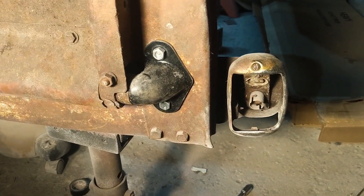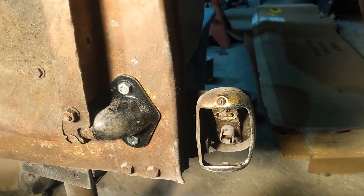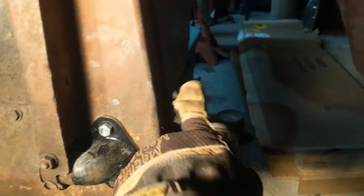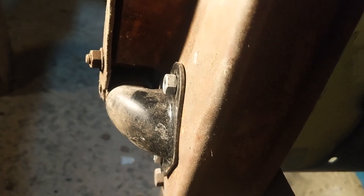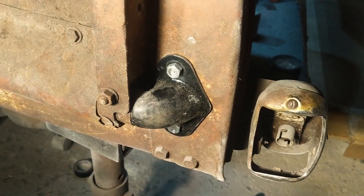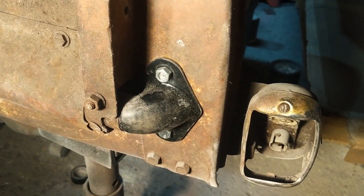The last final thing in this video is replacing this bolt here. For anyone who's worked on these beds, these are captive nuts and mine all rusted out. I've drilled everything out and just nutted and bolted it, which does mean there's a hole on the back side. I did have to drill a hole on the back side to gain access to the nut and bolt. It wasn't the greatest thing in the world but it was really the only way I could do it. Being a patina bed, I'm not too concerned. I'm going to flip this around and put in a longer nut.